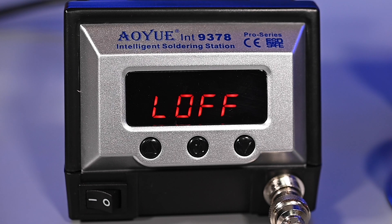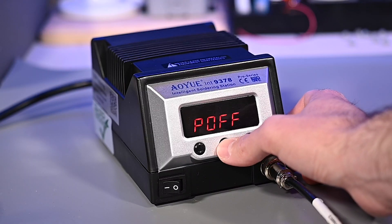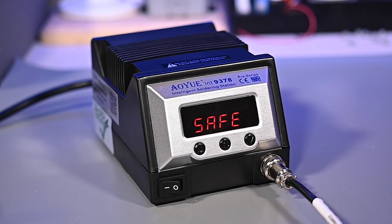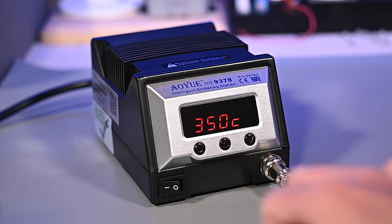This next item is a safety feature that allows you to lock the entire control panel to prevent any further changes from being made. For example, if the unit is set up and calibrated for specific functions, this can help stop those settings from being adjusted by other users. It is represented on the screen as L off, but can be set to on by pressing the decrease temperature button. After saving the setting, the display will show the word 'safe' to indicate it is enabled. To deactivate the system lock, make sure the unit is switched on, then press and hold all three buttons on the front panel for more than 15 seconds. The display should change from 'safe' to start reading the set temperature.